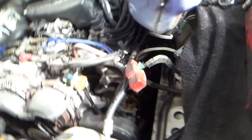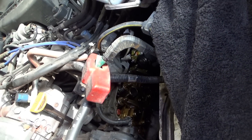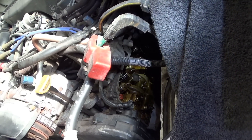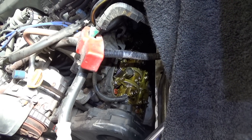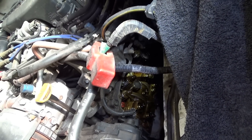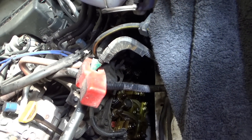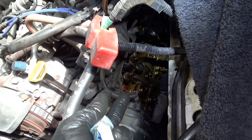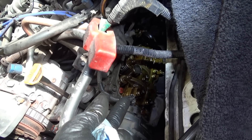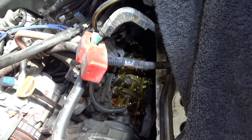Let's set the torque wrench — start with 70 foot-pounds and make sure none of these bolts are loose. I really don't know what would cause this issue over time. I guess these engines and heads can just slowly warp and cause this problem. That's what happened on the very first engine at 135,000 miles. Who knows how many miles the junkyard engine had on it — now it's at 199,000, so 62,000 miles later it's developing the same issue. Let's try to torque these head bolts.